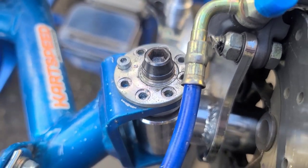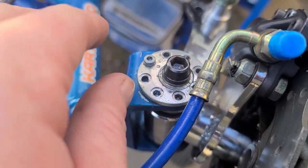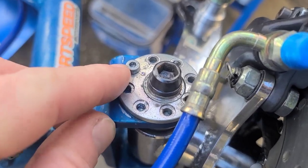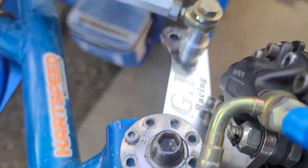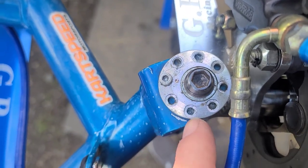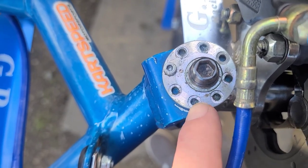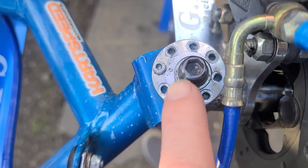Installing the Sniper camber caster setup. The easiest way I found to do this is take the original camber caster pills you've got in here, go 90 degrees from your current mounting hole — front and back — and you're going to want to use the correct size bit, but do a little pilot drill first.